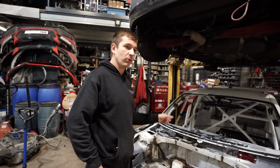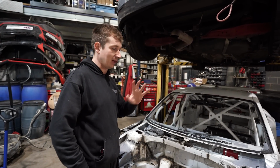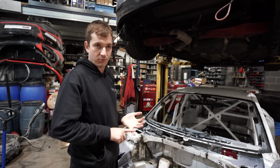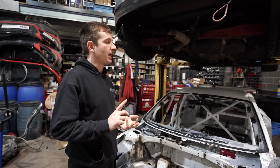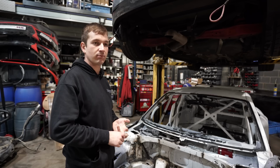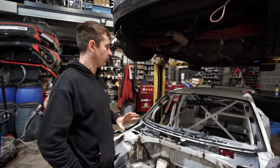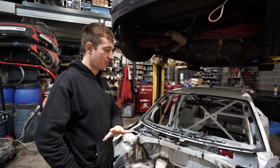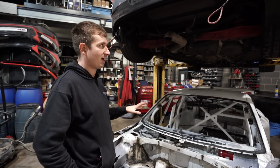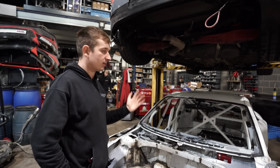This car, well, the one with a good engine, but this one's going diesel. So we took the engine out. We're getting rid of all the fuse box. We're going to do the same on the Golf as well. ECU Master Dash, ECU Master PDM, and still the factory ECU. And we're going to have a nice keypad for all the buttons and stuff, so that should simplify the wiring. So there shouldn't be a fuse box or any relays in both of these cars. Maybe we'll do it to the TT, but we're just going to get the TT like the TCR later on.